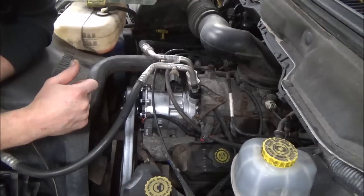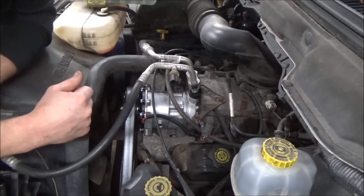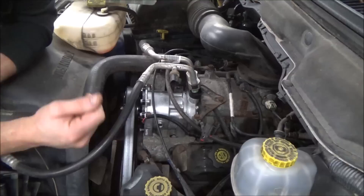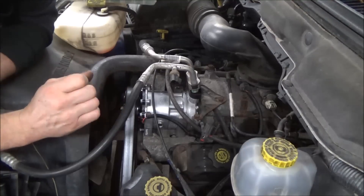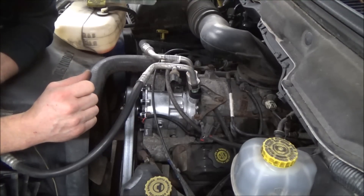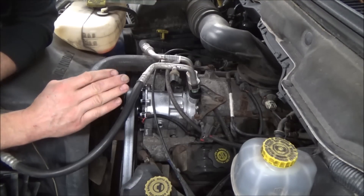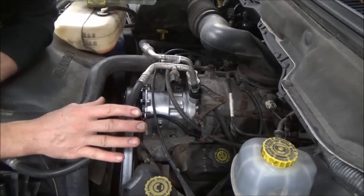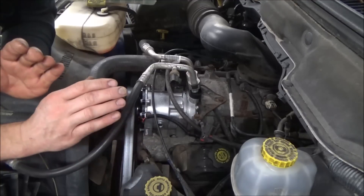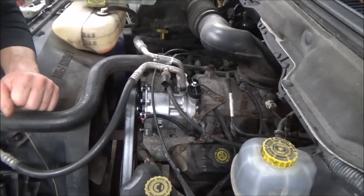I'll wait for you guys to get back up out of your chair, and here's why: we don't even know if this system works. Nobody knows. So I'm not going to put a pile of money into it to find out the condenser is bad or whatever. Also, it is my experience with these trucks — when you take the accumulator receiver dryer off, you're putting an evaporator in because it breaks the end of the evaporator. So given the age and condition of the truck, it'll be perfectly fine. Everybody just calm down.